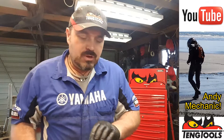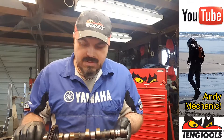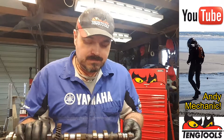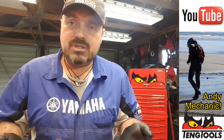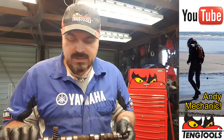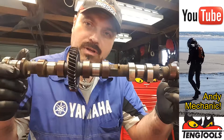On this very short video, I'm going to be showing you how to measure your camshaft lobes for wear. This video relates to both intake and exhaust cams, if you've got two or four or more. Or if you've got one cam, a single overhead cam engine or a single camshaft engine, then some of the lobes are going to be intakes and some are going to be exhaust. On this particular engine, the RAV4 engine, this is the intake valve camshaft.